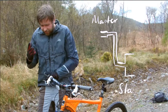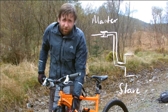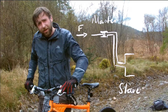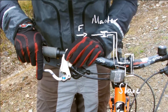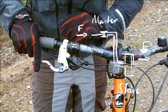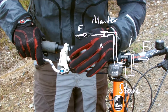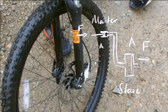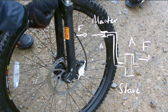So you can imagine I've taken my little finger force, multiplied it by 10 from the lever, then multiplied that by four from the hydraulics. That gives me 40 times the force of my finger on the brake pads — that's how the index finger can stop that front wheel. This piston compresses the fluid through the tubing all the way down to the piston on the brake pads.